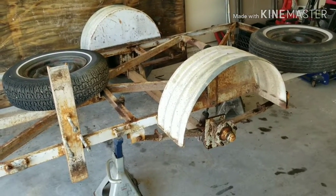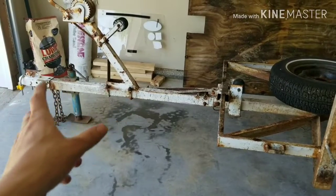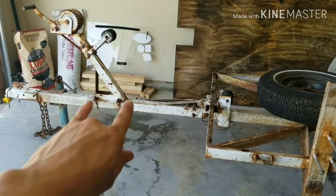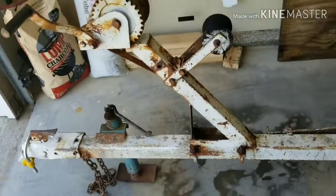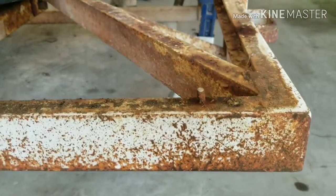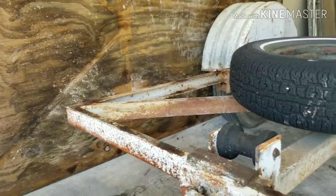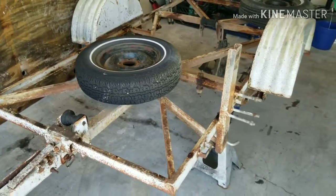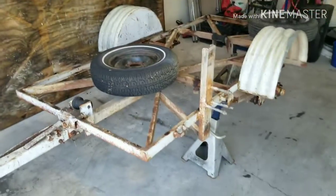The later project is to buy a scooter, put it on here, and take it to car shows. The trailer is kind of heavy on the front end because of how long the tongue is, so we're going to chop it down about six inches. There's also a winch on it. We've got a lot of customization to do, some broken bits, rust control, and bolts that held the board down that are rusted in — I have to grind and cut every one of them off. It'll give me something to do on weekends; it's about 90 degrees today.